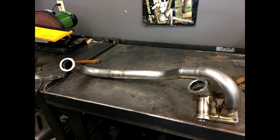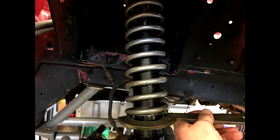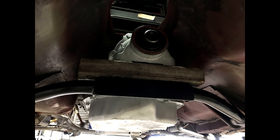People cut down junkyard driveshafts all the time — they just spin them to make sure they're true. We also got gears from a junkyard for about 28 dollars. The car came with 3.90s or 4.10s, which is a little too aggressive for the power level, so ideally a 3.73 or 3.55 would be good with a 28-inch tire. But we decided to go straight to a 3.27, figuring we're adding power almost immediately, so we didn't want to change gears multiple times.